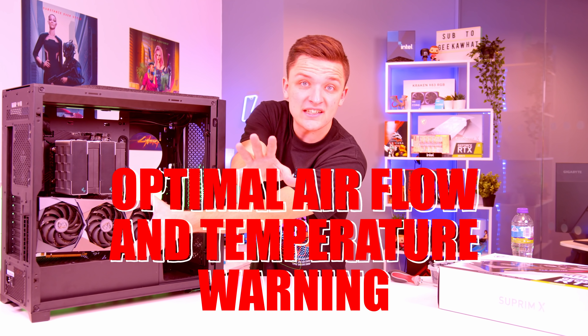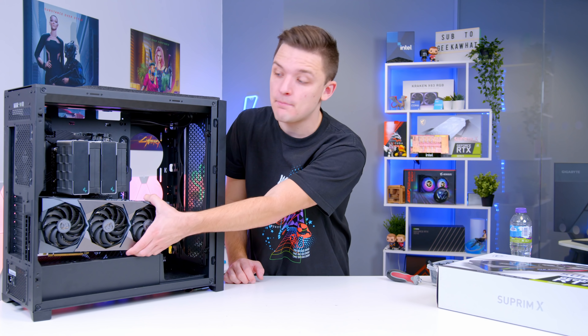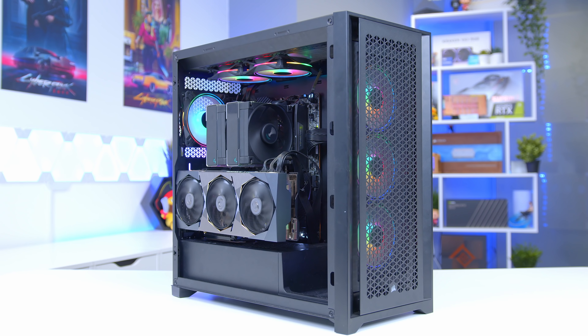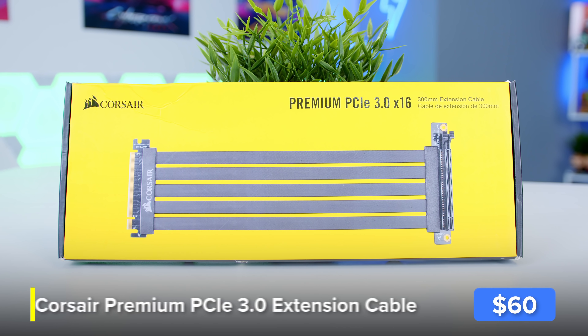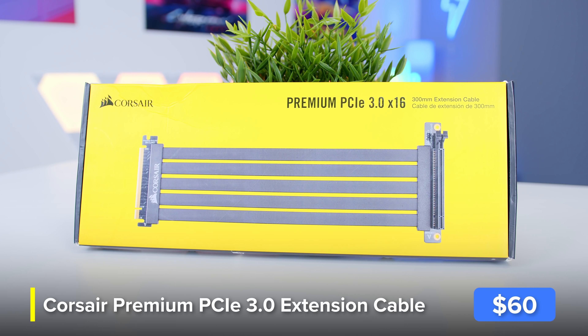Hovering the GPU in, that to me looks like it's going to fit. Full disclaimer: this probably isn't going to be the very best solution when it comes to airflow and temperatures, and if you'd like to perform better in that regard, pop it in the standard horizontal orientation. But for me today, I'm feeling like I want to take a risk and pop the GPU in vertically mounted — it will give us a much better aesthetic look and help the whole thing feel a bit less empty. Let's go ahead and get the GPU installed using Corsair's special uniquely designed premium PCIe riser. You can get these in PCIe 3 or 4.0 varieties, but make sure to set the settings in your BIOS to PCIe 3.0 if you've got a 3.0 version, otherwise your GPU won't output a signal and it won't work.